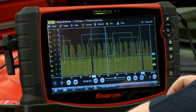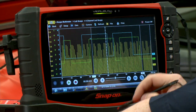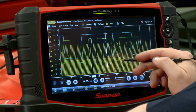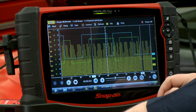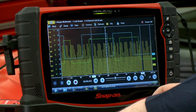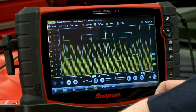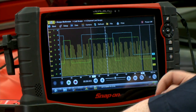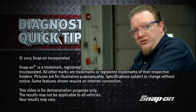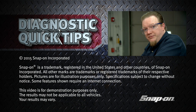Here is one revolution of the engine within these two cursors. This blank spot right here is top dead center on the crank, and we can also see how the intake cam and the exhaust cam time out against each other — the correlation between the three. If you have a cam timing problem, you could also do this with one single cam sensor and a single crank sensor, but check the correlation between them and that should help you diagnose it.